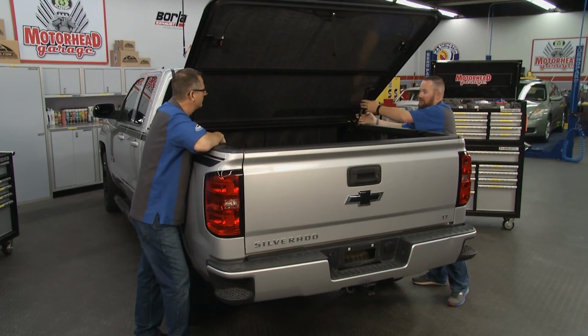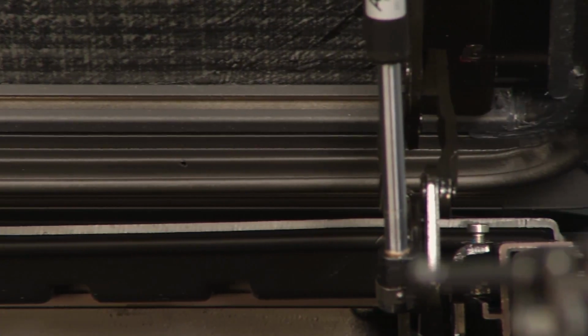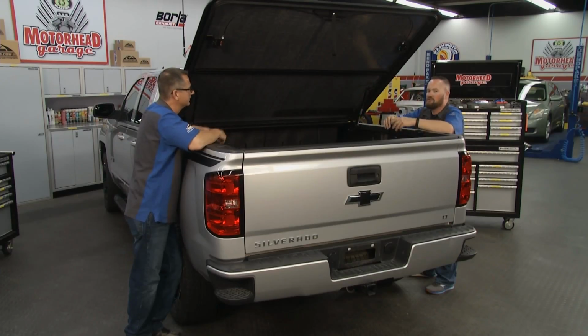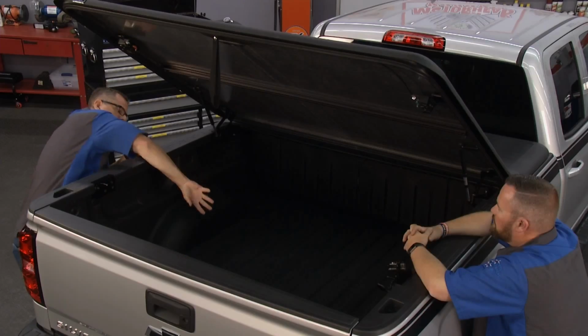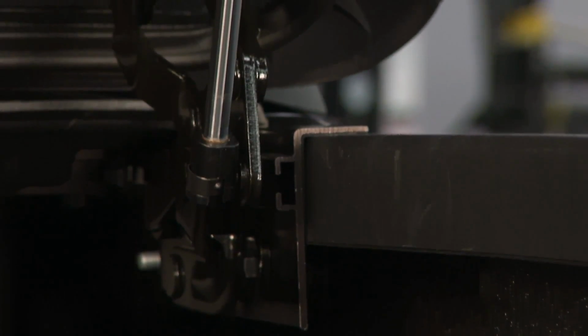When we look at the hinges, as you mentioned before, I think it's worth talking about because this is a 6-bar style hinge and it's 5mm width material. So they went very strong with these because the hinges are an integral part of making this a usable unit. And you think about it, a lot of these, I'm dealing with some kind of strut right here and I'm trying to get in the truck or trying to get something out. I'm working like this, or I have to come around to the front. A lot of thought went into this design, where it hinges and goes up to that 35 degrees you said. But look at all the space and room we have.